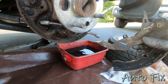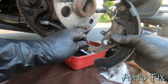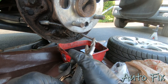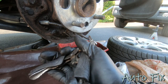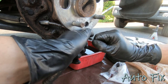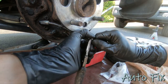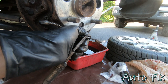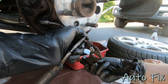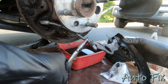Next I need to put the parking brake cable on — this is a little tricky. You have to pull the spring back and then insert the cable end into the lever. I'm going to lock some locking pliers very gently onto the spring to help pull it back, then hook it over. This is probably the hardest part of the whole job — but it's on, and that's all that matters.